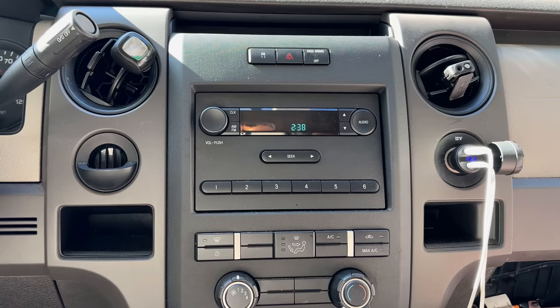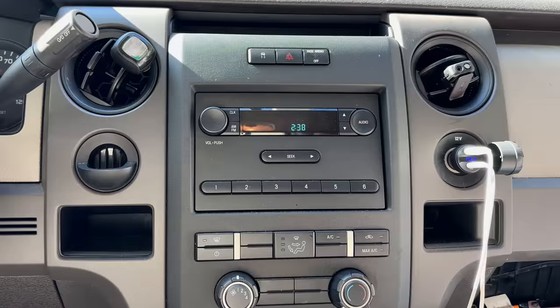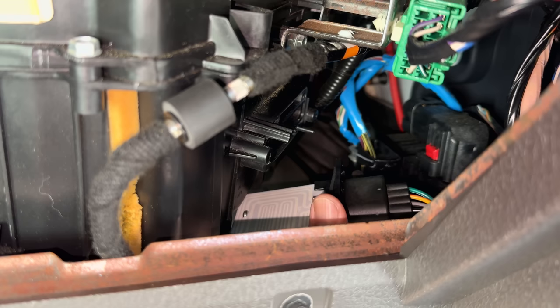So we'll turn it on. It's in the number one position, and I do hear the fan. It is blowing at a slow speed. Number two is also good. Number three, and of course number four. So that's all it was. Brand new part, unfortunately, was bad out of the box. So let me finalize this install and we'll call it done. Oh yeah, and that board is quite toasty already. So definitely don't want to run it for long without it being installed where it should be.